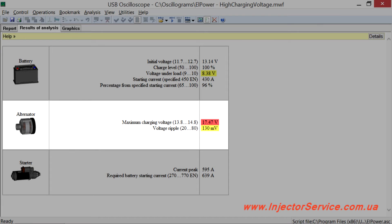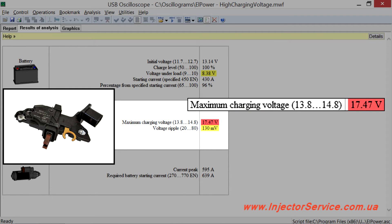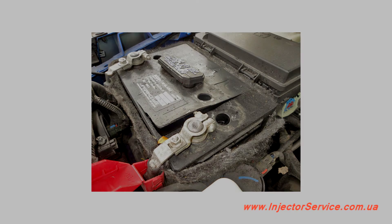In the following example, on the contrary, the voltage regulator is setting a very high charging voltage from the alternator — 17.5 volts. That is undesirable for vehicle electronics as well as the battery. Moreover, high charging voltage may cause intensive electrolysis of water in the electrolyte and rapid formation of gas. This gas is an explosive mixture of hydrogen and oxygen. An electric spark, the flame of a lighter, or an incandescent material can cause an explosion of a force sufficient to destroy the battery housing.